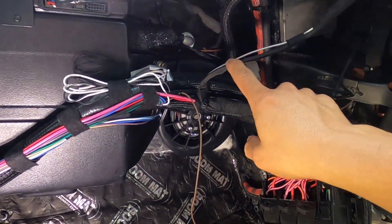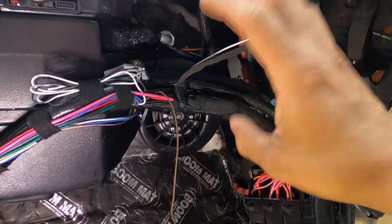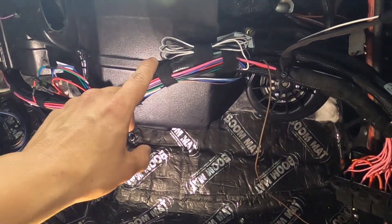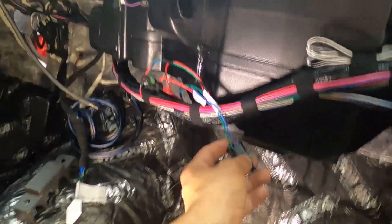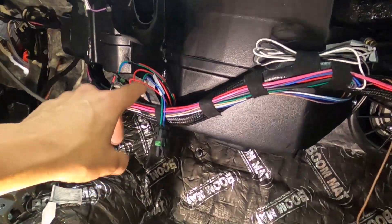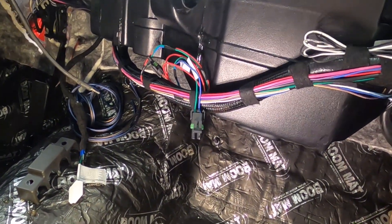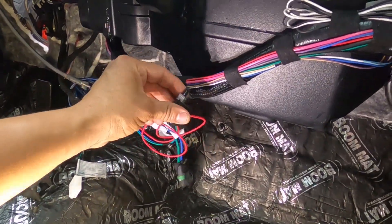There's also a white wire we added for the AC — when the AC kicks on it's tied into our Vintage Air kit and it tells the ECU to bring up the RPMs a little bit since the AC is on. From this harness you're also going to have two ring terminals that go back to the starter for power. You'll have fan wires one and two — basically a trigger wire slash ground, a direct trigger from the ECU — one primary, one secondary fan. You can program those to come on at different temperatures. And there's your red ignition wire. I like to put quick connects on everything because it makes life a lot easier.